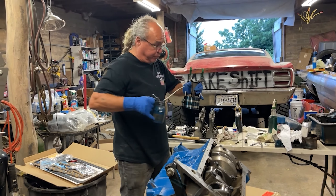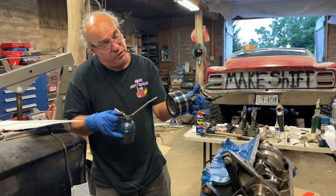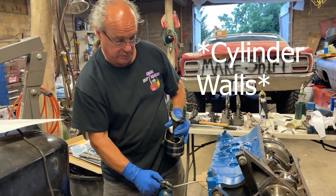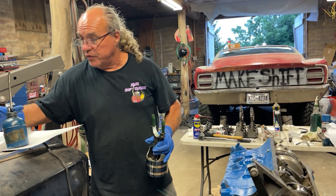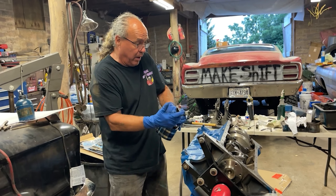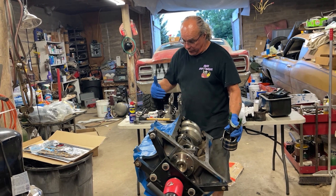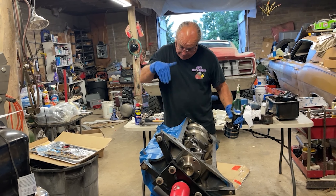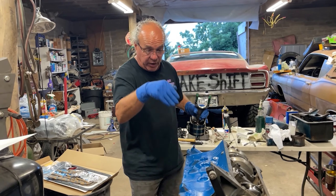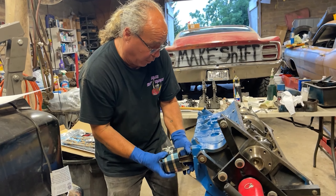First thing you want to do is make sure you spray oil on here, hit oil on here, then put your ring compressor on it so it's tightened down and all the rings are in there. Press a little oil in on the walls and make sure every piston is numbered. This one's four so it goes in position four. The way on a Ford you find it is the head closest to the front — that's number one. The other one's kicked back a little, so that's number one, two, three, four. Number four facing out — that's how you want to do it all the time.